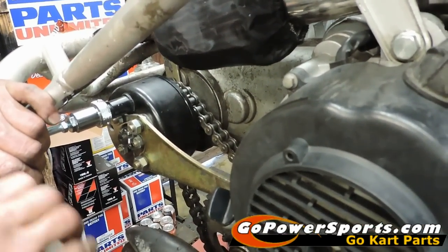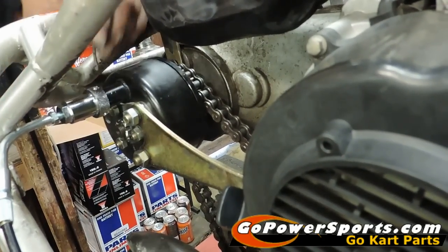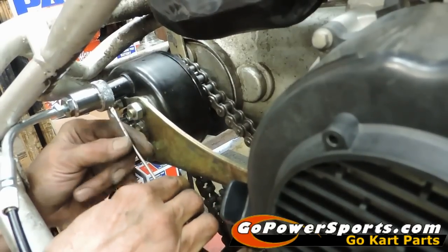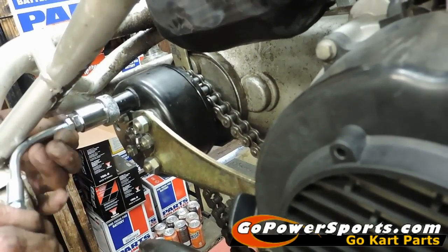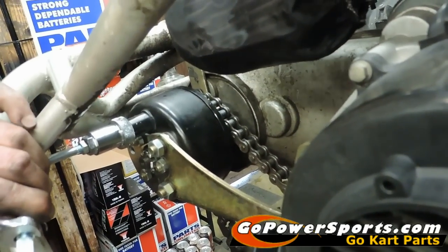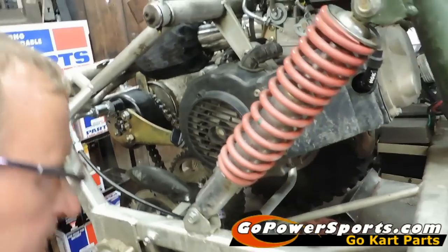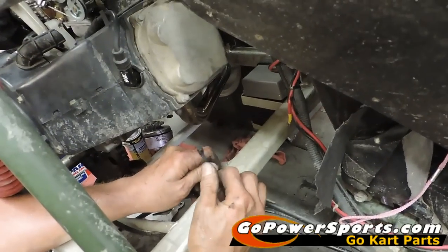We're going to come back to the back. Scott's going to slip his cover back on and put the screws in to hold it in position, and then tighten down his jam nut here as well as up here. Then we're going to put our zip tie in the middle of the cable and re-zip tie your brake and your hydraulic hose — we like to use two zip ties for a backup. That keeps them off the ground and keeps them from hanging up on brushes.